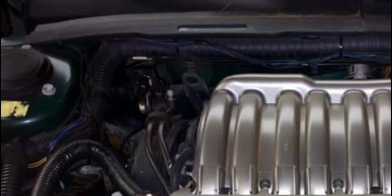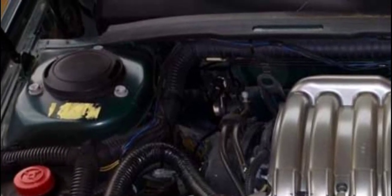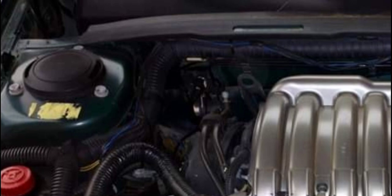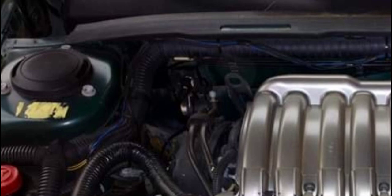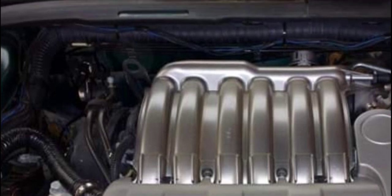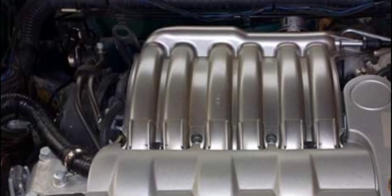Then somewhere here, at least here, in between the intake manifold and the timing chamber cover, the rear cylinder here, no matter what you do, don't let water get to that place. Because the water that will pass from this intake manifold chamber will go and settle on bank 1, the bank 1 spark plug and ignition coil chamber.